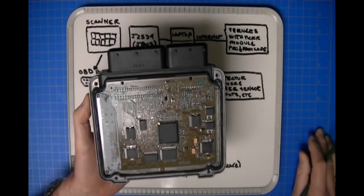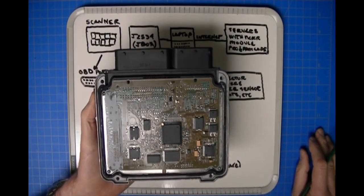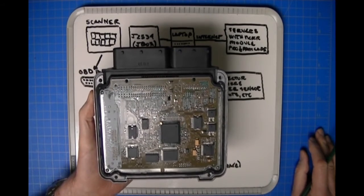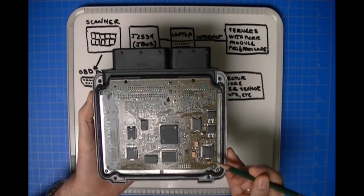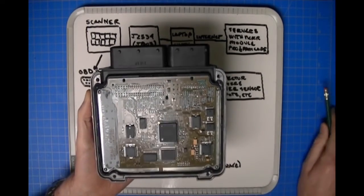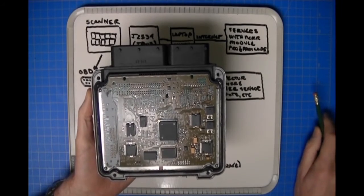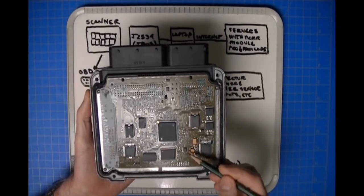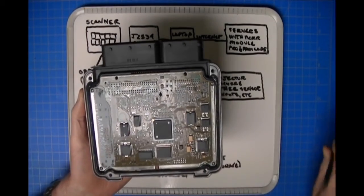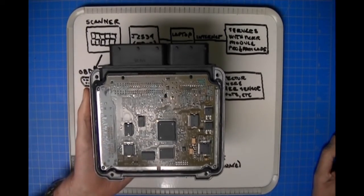All right, you can take a defective module, and it just has to have one defective part. Like I said, just for my example, I'm assuming that the injector driver here is bad. That renders this module dead. But the information in the little EEPROM is fine. It's just not right for the module from the salvage vehicle.